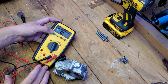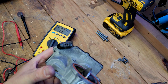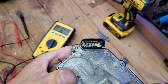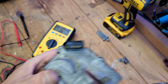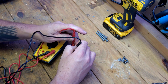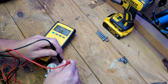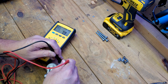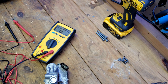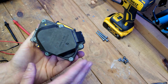We've got our multimeter set up. You need a digital multimeter that can read ohms to do this test. We have the bypass valve here. What we're testing for are pins four and five — we have a five-pin connector, and on this one it goes from right to left: one, two, three, four, five. So we're testing the last two pins on the far left. The reading we should get is 2.4 to 4.6 ohms. My reading is holding at 7.9, 8.8 — well outside the parameters. So I have a bad bypass valve. That's what's giving me my codes.